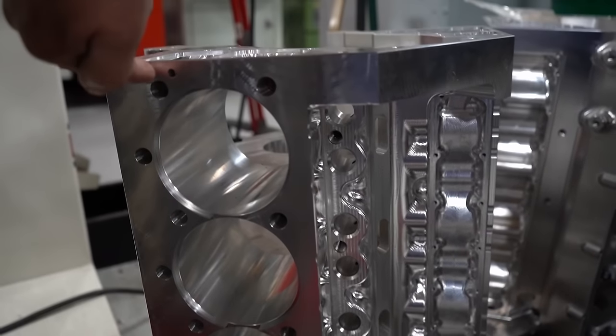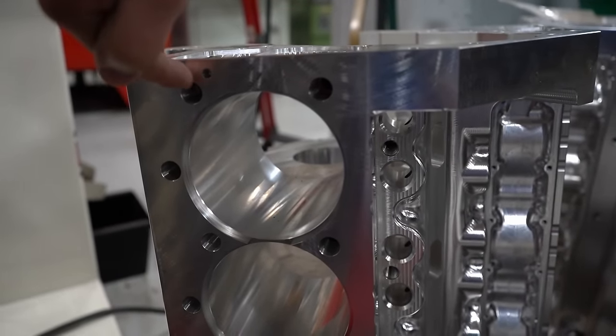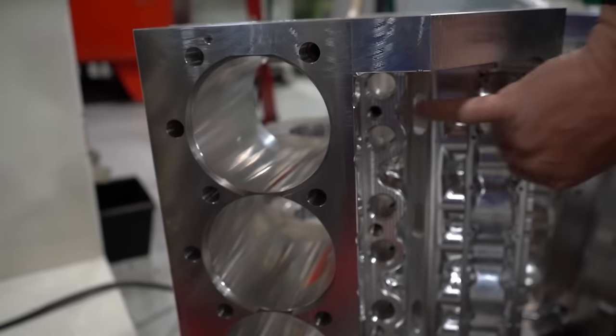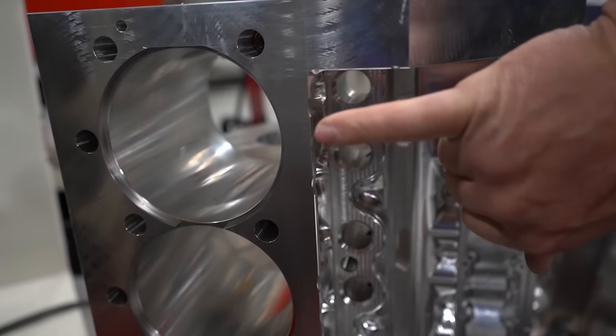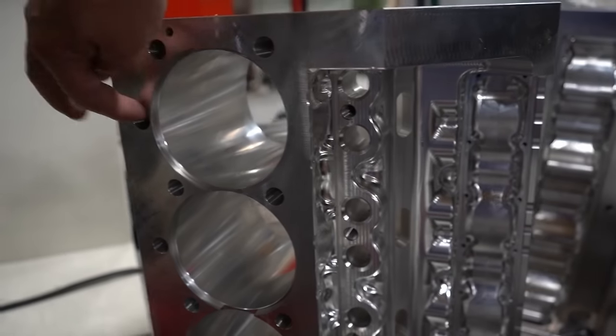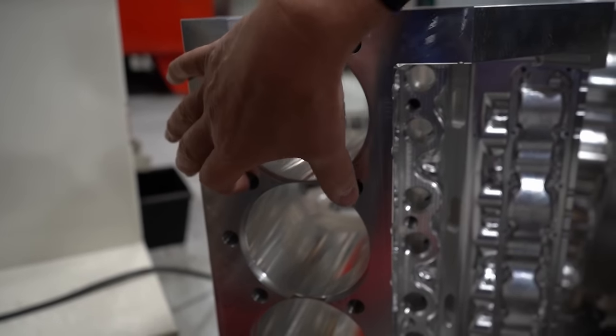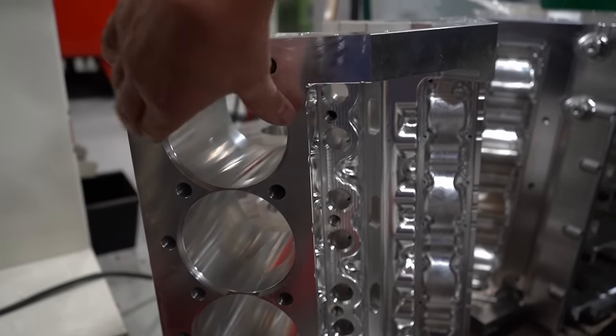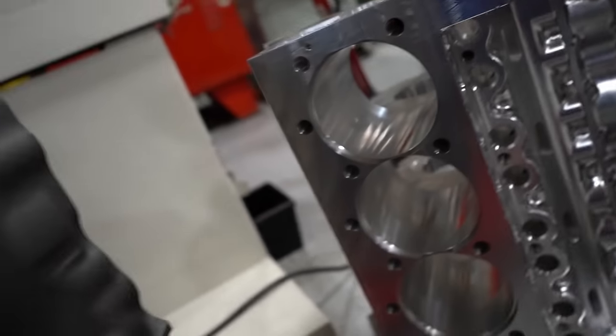Now, notice that altered head bolt pattern. I talk about this all the time, but it is important. There's actually a head stud that goes right here through the intake port, and we'll show you that on the cylinder heads here. Half-inch head stud here, half-inch head stud here. Revised, move these in so it's a more symmetrical pattern all the way around. Ultimate cylinder head clamping for LS.